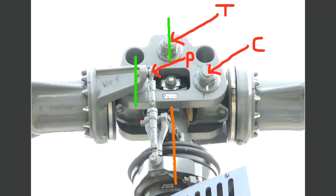Another thing to note is that the rotor mast is not in line with the rotating swashplate. If it was, then the phase lag would be 90 degrees. But on the R22, it is 72 degrees. Rotor discs take time to change angle — for the R22, it is 72 degrees of rotation. This can be referred to as aerodynamic precession.